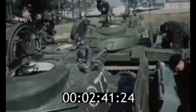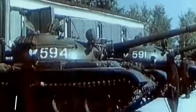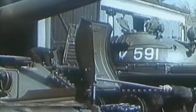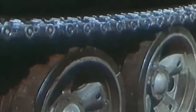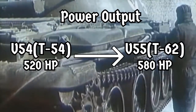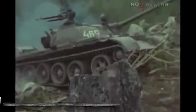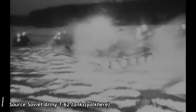The power plant of the two tanks was also effectively the same. The T-62 had essentially the same engine and transmission as the T-55: a V55V liquid-cooled naturally aspirated V12 diesel engine. The only difference from the T-55 was that it had a more powerful generator to cope with the power needs of the T-62's gun stabilizer — a clamp-on accessory that did not change the structural design of the engine itself. Compared to the basic V54 used in the T-54 series, the V55 upped the power output from 520 horsepower to 580 horsepower by having the engine put out more torque across the same range of engine speeds. Conveying this engine power to the tracks was done by a simple manual mechanical transmission with a multi-plate dry friction clutch and synchromesh gearbox of conventional design.